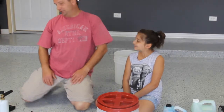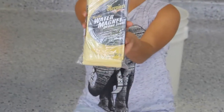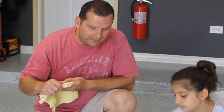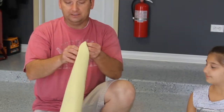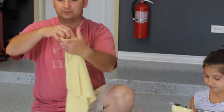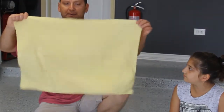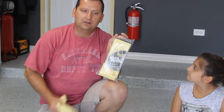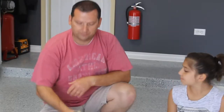The next thing is the waffle weave drying towel. The one I have here is, in my opinion, phenomenal. Meguiar's makes this — they call it the Microfiber Water Magnet Drying Towel. I love it, it's a perfect size and it does what I need. Once it gets saturated with water, I fold it twice and if it's wet I can squeeze it out. I've tried the Adams towels — they're twice as big and you just can't seem to wring them out, which is really annoying. This one is absolutely the perfect size. It absorbs everything and doesn't hurt the paint at all. If you get the Meguiar's drying towel, don't use it straight out of the package — put it through a wash first. It will be more absorbent, and make sure the towel is damp as well to make drying a lot easier.